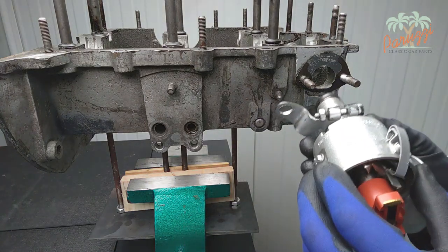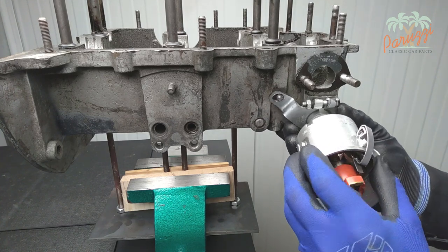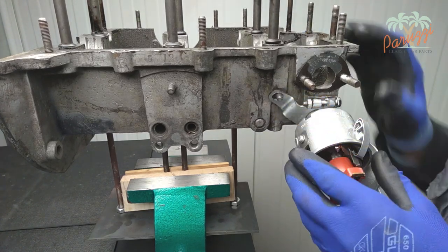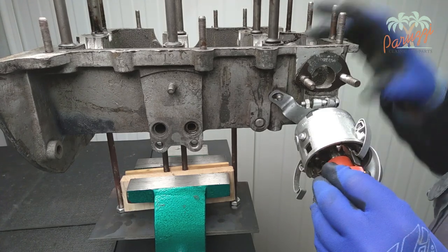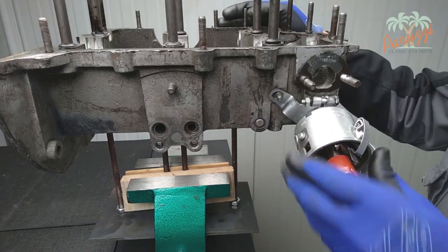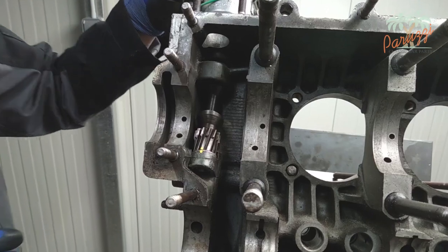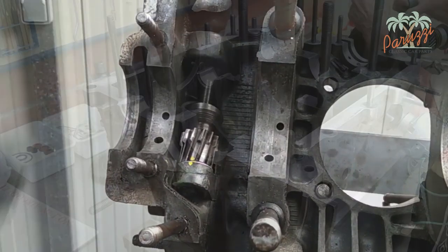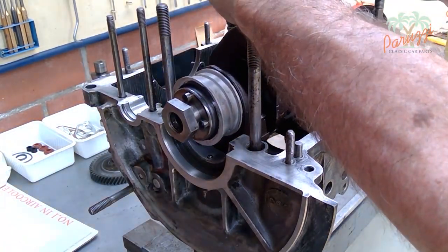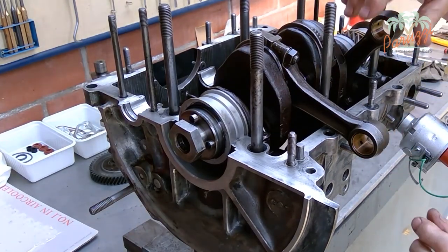You may now mount the distributor with the smallest half at the bottom on the crankshaft pulley side. Turn the rotor a little to get the distributor to engage the drive shaft. Return the drive shaft to its base position before installing the crankshaft — the paint dots will help you find the correct position. Next, assemble the crankshaft with the connecting rod of cylinder 1 in the top dead center. We will explain the assembly of the crankshaft and camshaft later in this video series when we rebuild the engine.